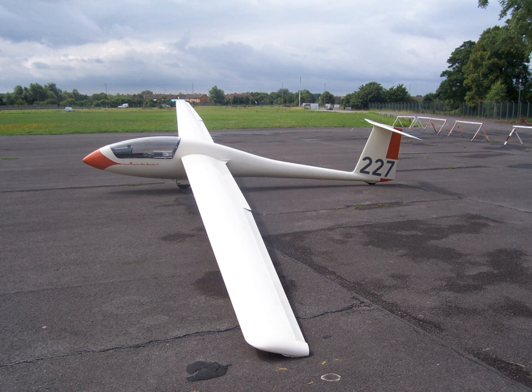Wing area, 9.86 square meters, 106.1 square feet. Aspect ratio, 22.8. Empty weight, 235 kilograms, 518 pounds, 215 kilograms, 474 pounds, with carbon fiber wings and tail unit. Max takeoff weight, 500 kilograms, 1,102 pounds. Performance. Stall speed, 80 kilometers per hour, 50 miles per hour, 43 knots. Never exceed speed, 250 kilometers per hour, 155 miles per hour, 135 knots.